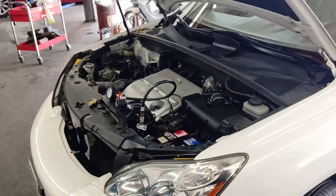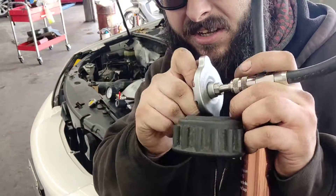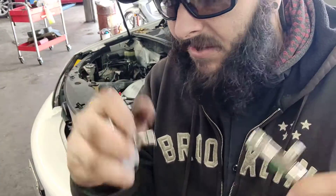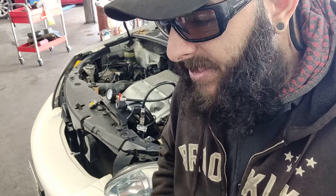Those universal pressure testers use a little quick-disconnect fitting — if you've got one of those universal pressure testers, this just clicks right on the same way. So you don't need any special connectors, unlike say the OTC inline coolant tester which has a special Schrader valve thing. Matco and Snap-on may have their own proprietary versions, but generally all the big generic cooling system pressure testers use the same fitting. Alright, that's my five-minute tool review.